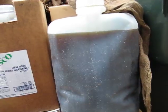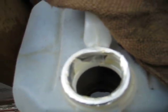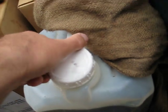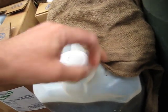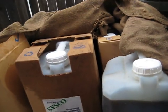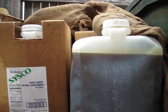This oil looks dirty — it should look a little bit dirty, it's been used. It's been settling for about a week. I like to let it settle for two to four weeks before I use it. If there's any dirt or water, it'll settle down to the bottom and you can pour off the top slowly and carefully.